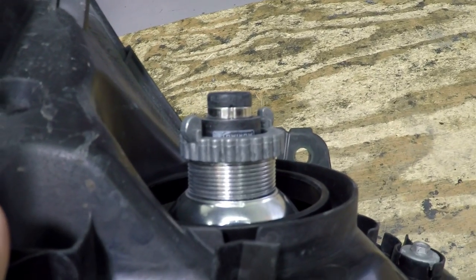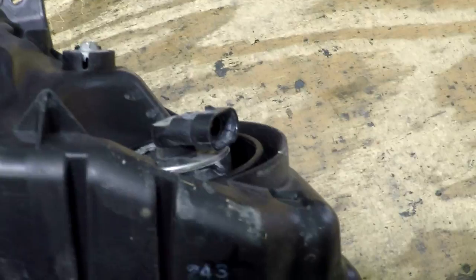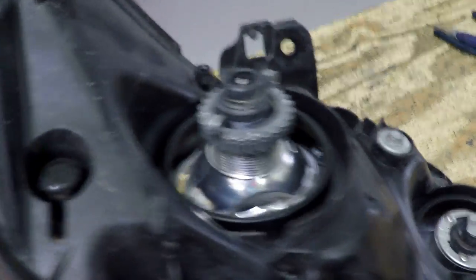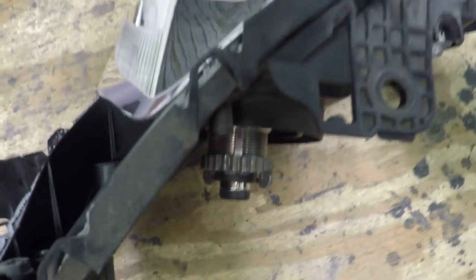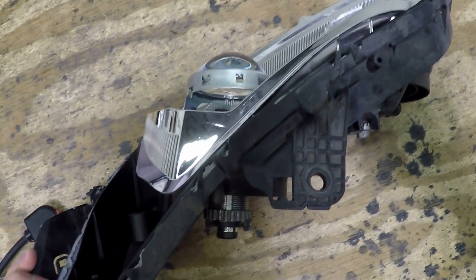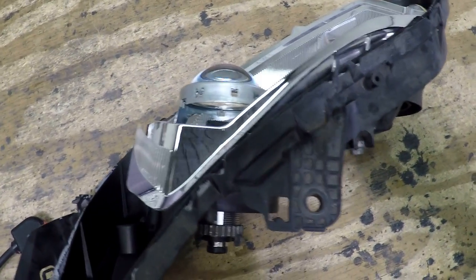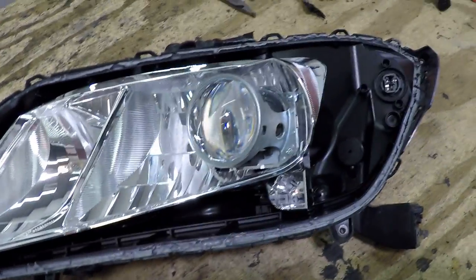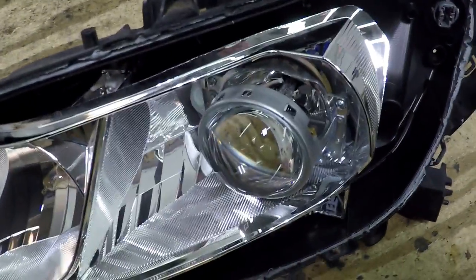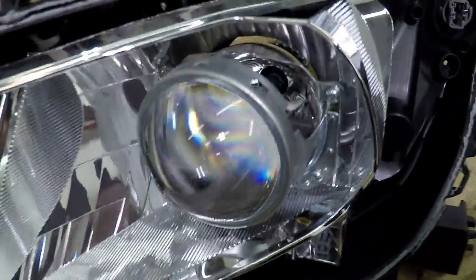You can see the shaft of the projector sticking straight out the back, nice and even with the high beam location. We still need to point the projector in a bit more, but the left and right looks pretty good. Final adjustment will be verified on the car. The Civic has a fixed left-and-right adjuster — it only has an up-and-down adjuster — so when you have a fixed adjuster you better hope you get it right, otherwise you're checking it on the car because there's no other way.